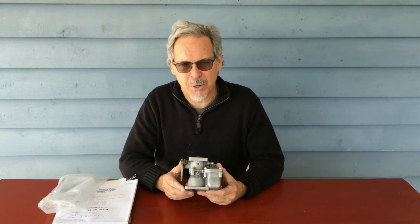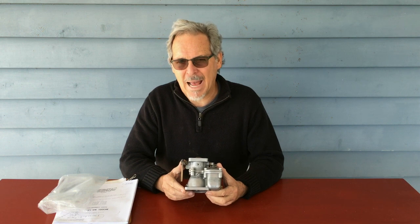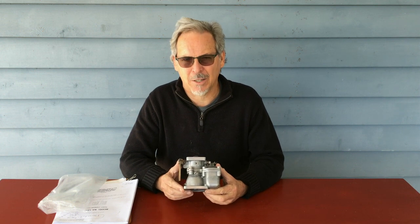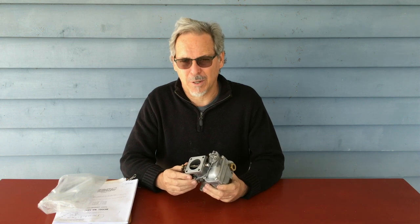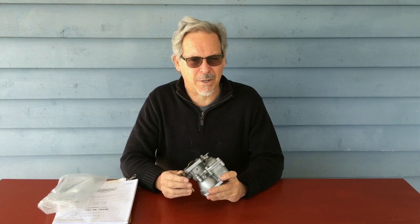This particular carburetor belongs to Thomas Klepper. It was built exactly according to the book and it did not run well. We took it apart and carefully measured the brand new jet on it and it was not correct. So when new parts are being delivered in bags from known suppliers and they are not correct, it's impossible to recommend this to a home builder and have him put it on his airplane and not understand why it does not run correctly. The system has bogus parts in it now and the rebuilds on these have gotten very, very expensive.